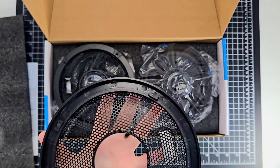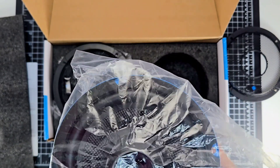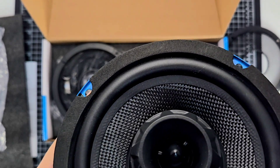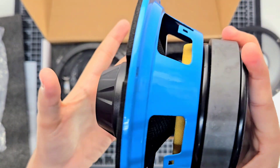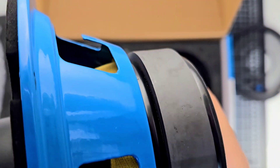Designed to conquer the road, it features a 4 ohm impedance and is equipped with a 38.5 millimeter voice coil, enhancing its ability to handle a wide frequency range from 50 Hz to 15k Hz. With a sensitivity of 98 decibels, the F165 delivers audio that's not just loud but also exceptionally clear. These speakers were built with durability in mind, featuring a glass fiber cone with a rubber surround that can take a splash or two.